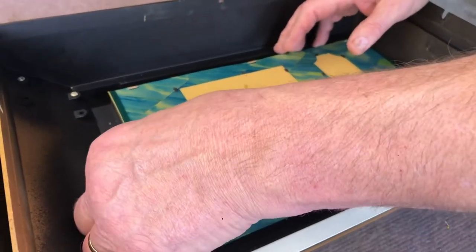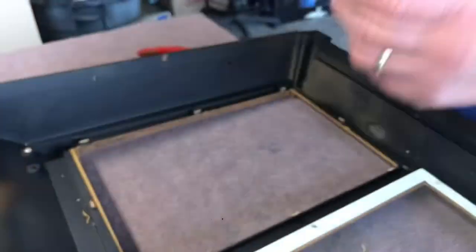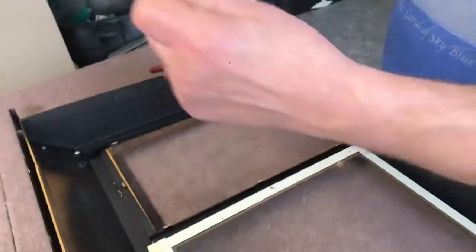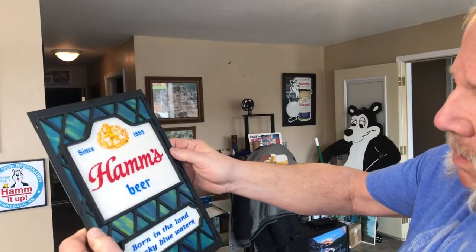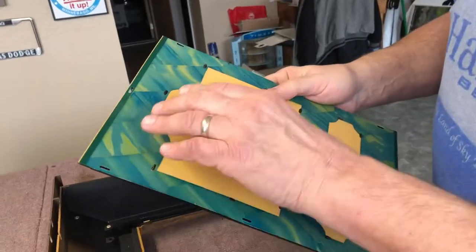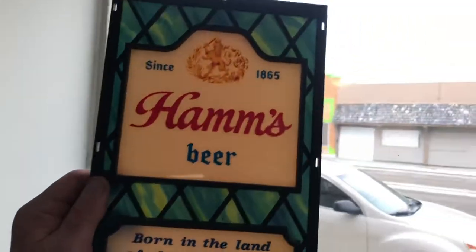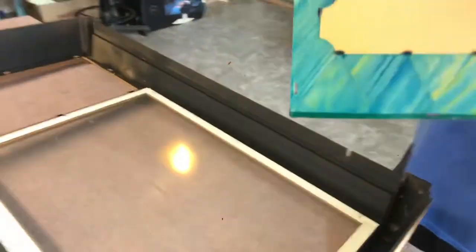When you squeeze the tabs, that melted portion comes off, leaving just the little tabs, and then you can lift the entire assembly carefully out. Now, if you're going to save this blue marble — which this one actually is in pretty good shape — you have to be really careful because, as Barry said, this is very fragile from the heat of the light bulb. It's a little yellowed, but if you hold it up it looks really good. I'm going to reuse that. That's how you get them out without damaging them.